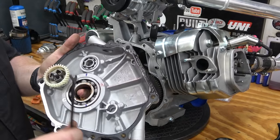Of course, we're going to tune it out so we're around 7 to 8 pounds of boost. And of course, that boost is going to be more when we're under load. So this is dangerous levels right here, blowing the engine up.